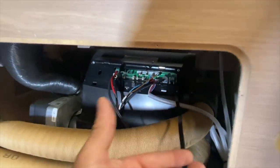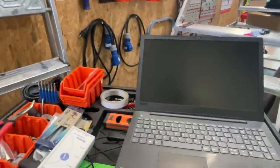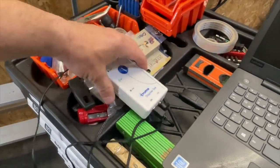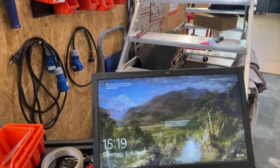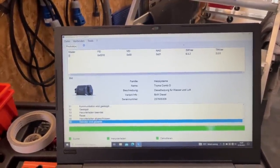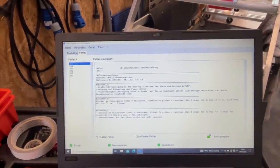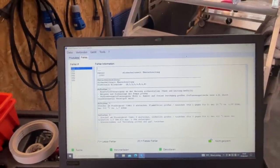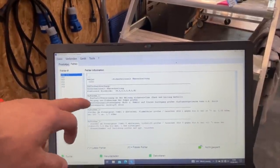I've connected our test cable and we'll now read out the whole issue. We have a readout device from the company Truma where you can read everything out. You connect it to a PC - nothing works without a computer these days. So we're reading out the heater together now. We can see that it found the heater - power is present, the circuit board is working. It's a Kombi 6 kW heater. And here we can already see the first errors. Error 52 is showing up.